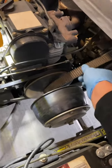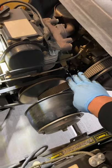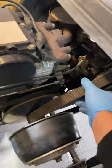We're gonna start by removing the drive belt first, because removing it will access the generator belt and allow us to take it off once we loosen it. Your drive belt is located right here. Set the parking brake, make sure your ignition is turned off. To remove the belt, pull up on it to get a little tension, move it to the side, then use your hand to push it all the way down and slide it off the secondary clutch.